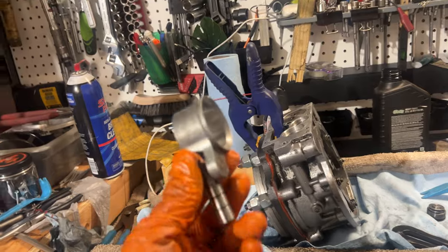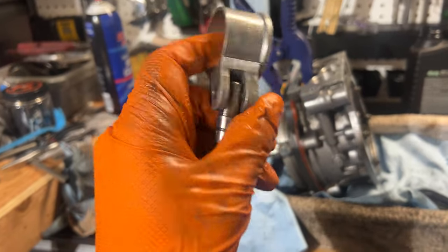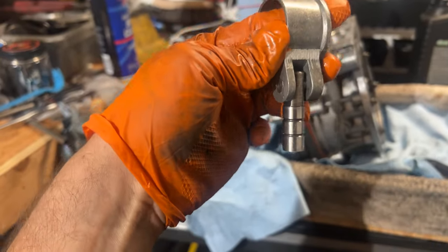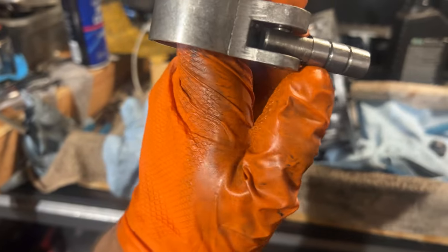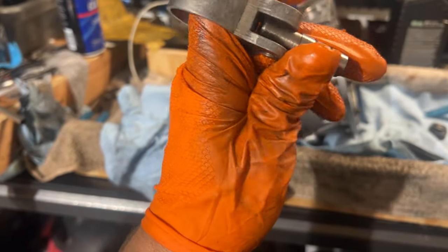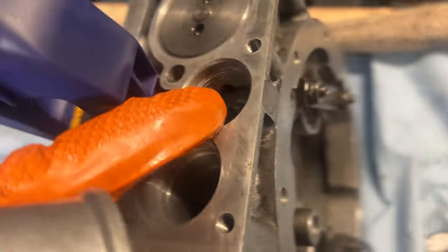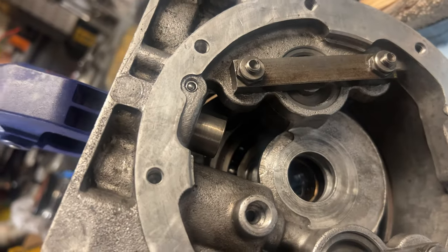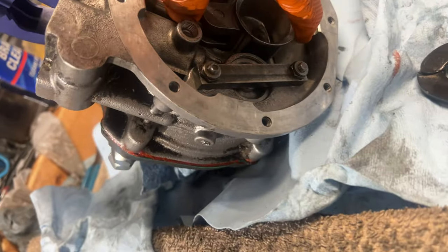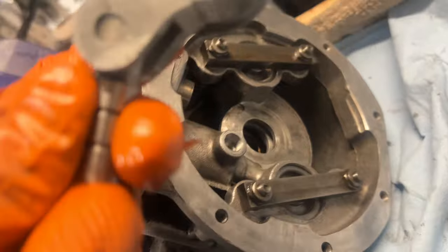Discovered what was holding up the entire pump assembly, and that's the fact that this has a little bit of wiggle left to right. You can see in there, there's a pin that drives through the center of the pump, and you can see it's got that much adjustment. This piece here with that little wiggle is binding up on the valve, kind of a collar or sleeve, whatever that is in there. So when this is sitting inside of the overdrive, it was essentially not going to mate with that because the backside of this was sticking out too much.